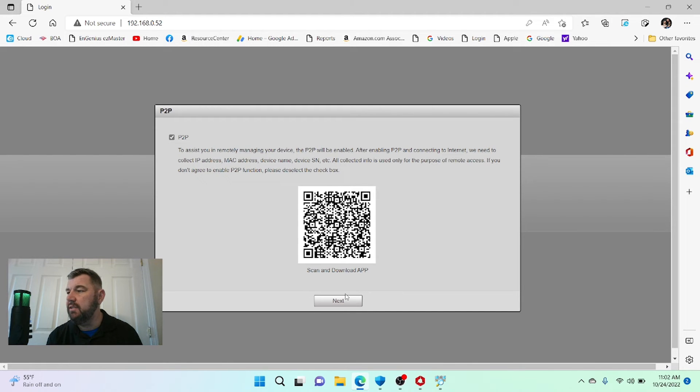The initialization process has finished. If this were a standalone camera, you could download Dahua's DMSS phone app on your phone, scan this QR code, and put in the administrative username and password — it will automatically connect to your IP camera remotely by P2P. So if you use the micro SD card option with onboard storage, all you have to do is download the DMSS phone app and scan this QR code to live view and play back the camera.